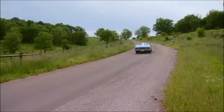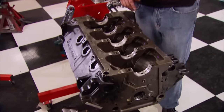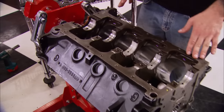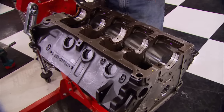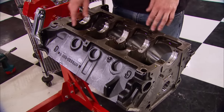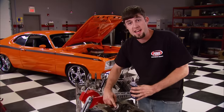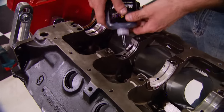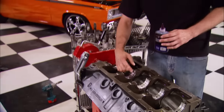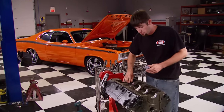Today we want to change that. Since they had a production run of 30 years, boneyard 360s are still really easy to find, like this one we recently had machined for our budget build-up. It's easy to identify what block you've got by simply looking at the casting number on the outside. Another cool feature is that all the 318s, 340s, and 360s are made of a high nickel alloy — the same material other manufacturers only use in their special race blocks.